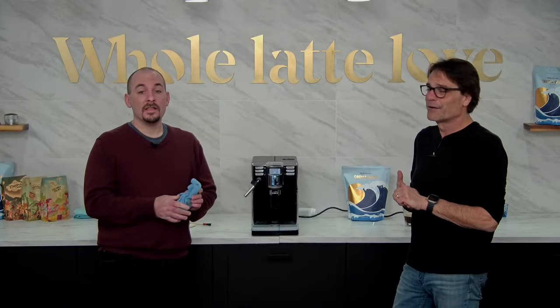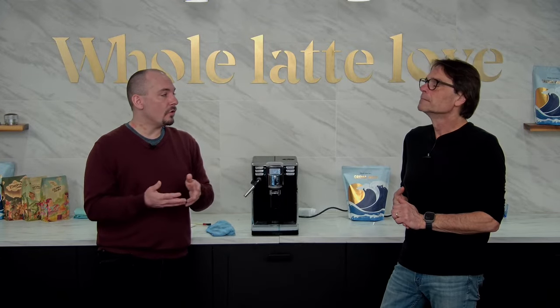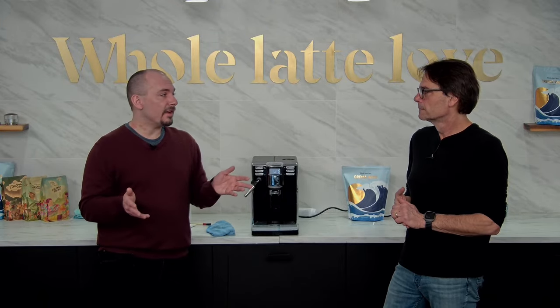Yeah, would it be okay to use really dark roast coffee in this machine? That's a great question. So the answer is going to be no. And unfortunately, the oils on the coffee, especially if you've ever opened a bag of oily coffee, you'll see it's coating all over the inside. It's on the walls, and then it's on the beans too. It'll get on your fingers. All of those oils deposit on the inside of the machine. They deposit in the hopper. They slow the feed of beans down into the grinder, which can throw off the algorithm. They gum up the inside. Yeah. All of these delicate mechanisms in there that are designed to work properly get gummed up, and then it's very difficult in some cases to actually remove those oils once they've gotten inside the machine. So yeah, dark roasted coffee with a lot of oils is definitely a no-go.